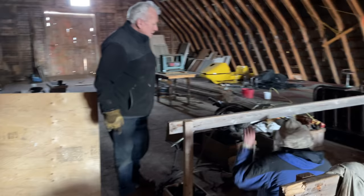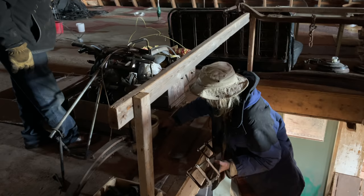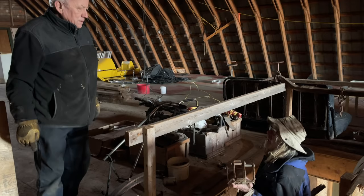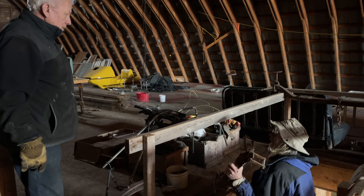This is the springs to bring it up to a 3/4 ton. And I'll tell you, it sits in the air pretty high. You could put 10 engine blocks or a car on the back of that truck and she wouldn't squash down. I think you could carry 2 cords of wood and it wouldn't squash down. Originally, it had rubber bumpers on the frame because the rear end never goes up and hits it. I got the rubber bumpers off the car and the holes were in the original frame for the rubbers, but they weren't there. On the car, one of them was missing. I gave them to you. They're in that box. Perfect.